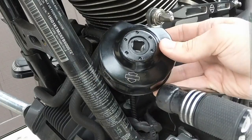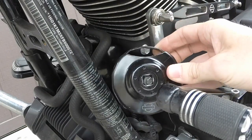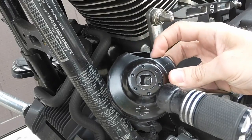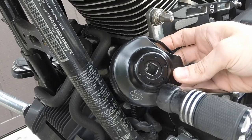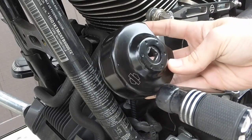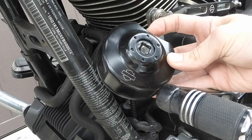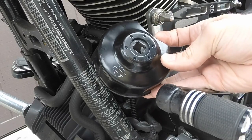So let's take a closer look at it. Here it is — extremely basic, yet super helpful. It has a notch right here. That's for the crank position sensor. When you're twisting it off, this comes closer to you, which is closer to the sensor, because you're unthreading it. And this is so you can install it and remove it with ease.